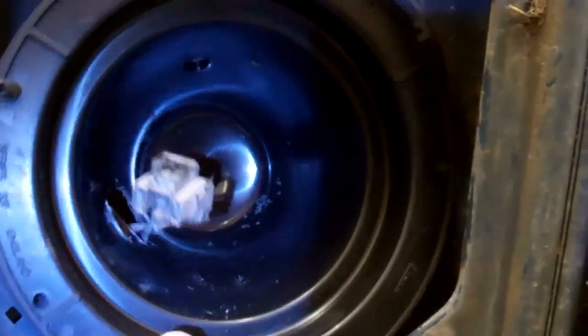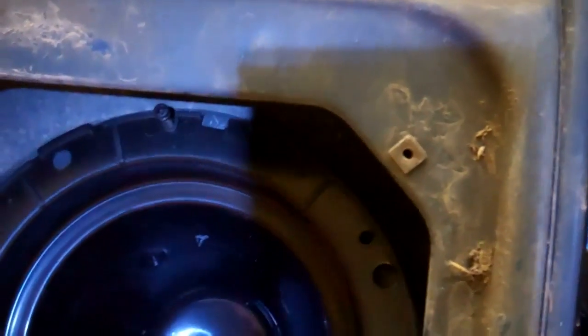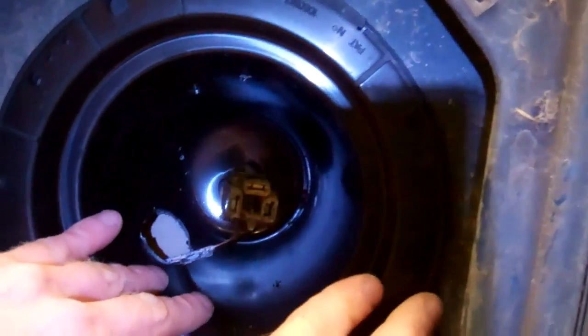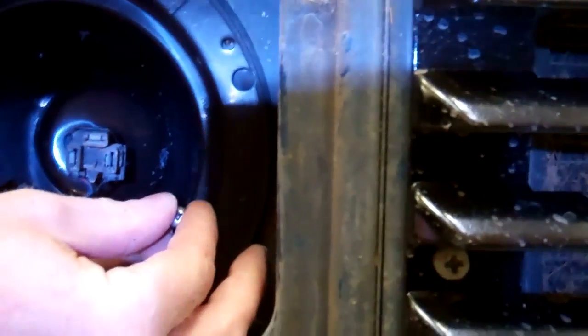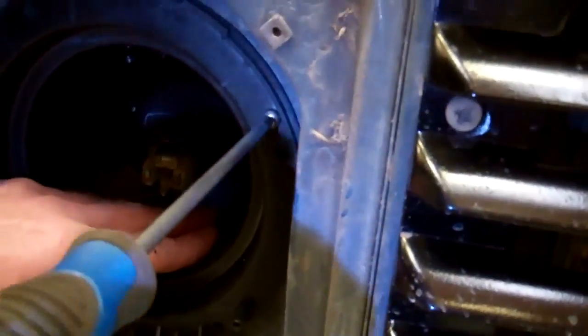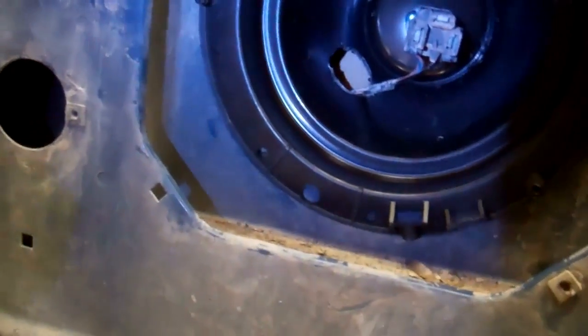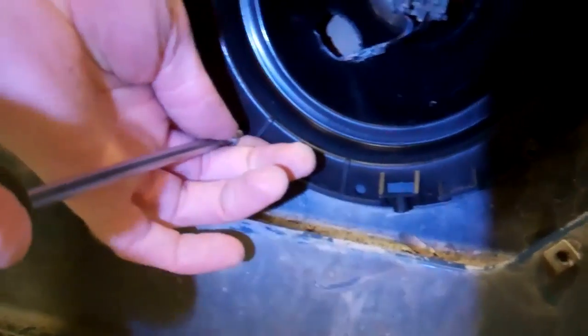Okay, so we've got the rubber seal on. We've aligned our 2 adjuster screws, which are our reference points at the 9 o'clock and 12 o'clock positions, and now we're ready to fit the new stainless screws into those 4 holes. And they don't look badly lined up there, do they, Tom? No, they look okay. So I get the first one in. Don't do it too tight until you've got the others in. Right, once we get another one in opposite, we'll be okay.